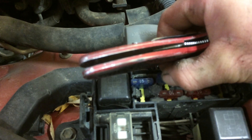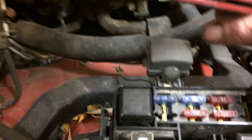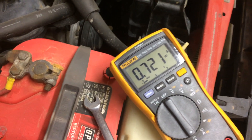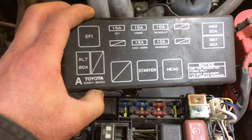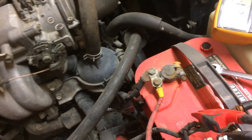That would have been the way to find the circuit giving us problems — just go through and pull fuses, then look on the diagram on the back of the cover. We know that was the dome fuse. But if we didn't know that, we'd just keep going around and pulling. It could be the hazard light, it could be anything on multiple cars. That is how you test current draw on a car.